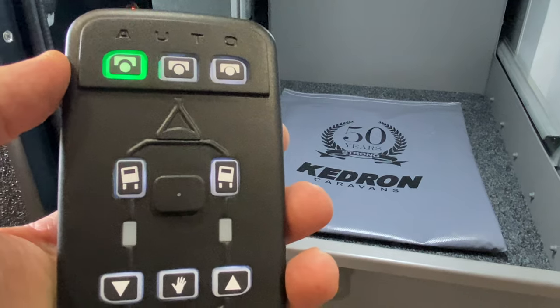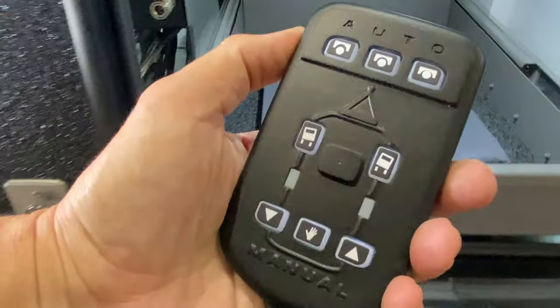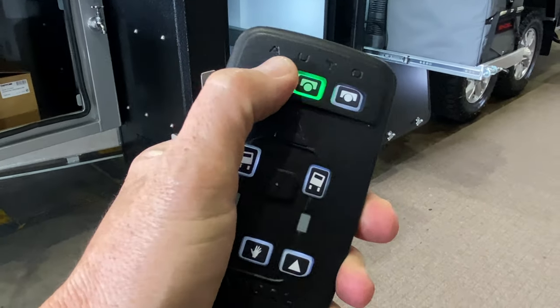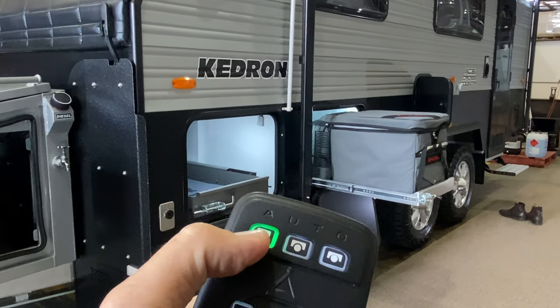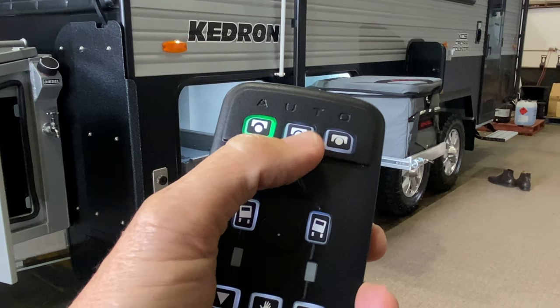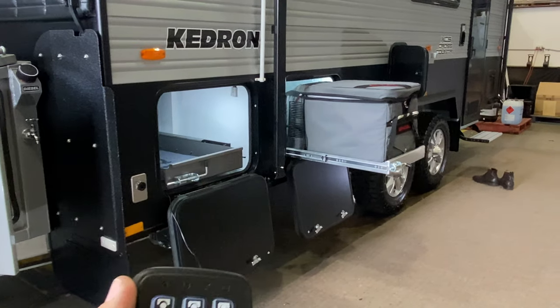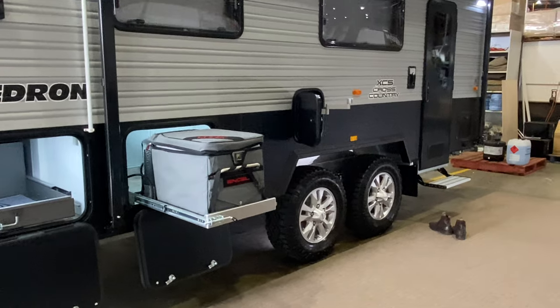As we're saying, the auto leveling suspension. So that there on the auto level. So if you are towing in off-road, say, so we'll just go back to off-road. If you're towing in off-road and you go over about 80 kilometers an hour, the speed sensor will pick that up and drop the van back automatically to the lower highway mode, just for a nice safe tow. Gets the center of gravity down and just gives it a nice stable tow.